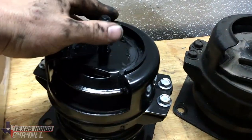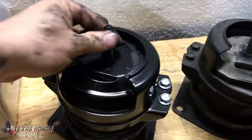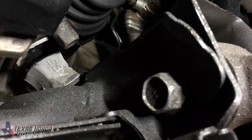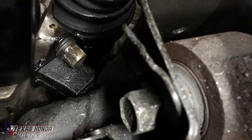Here is actually how bad the front motor mount was — as you can see, that thing's completely destroyed. It is done for, and it's been like that for a long time. Here is the transmission mount — it's fully separated completely. Now it's fixed and good to go, so this thing is definitely putting more of that torque directly to the wheels.